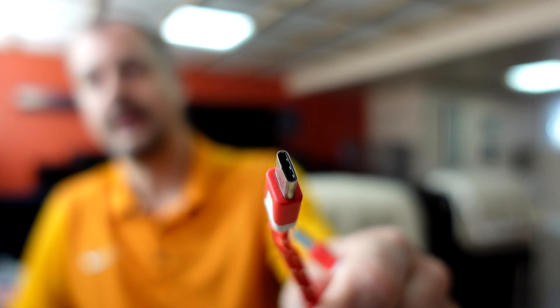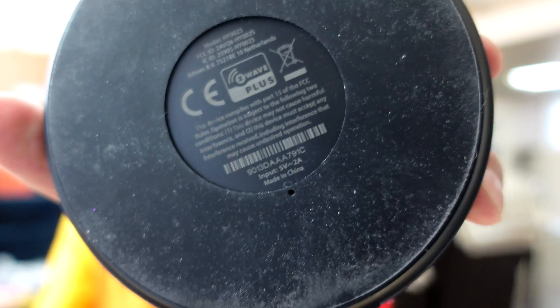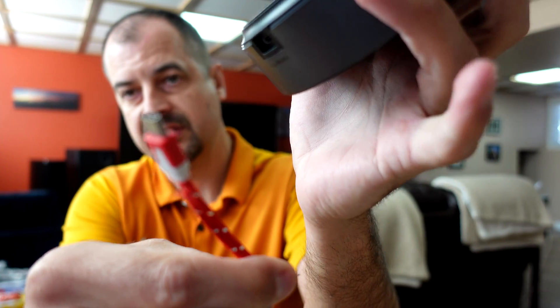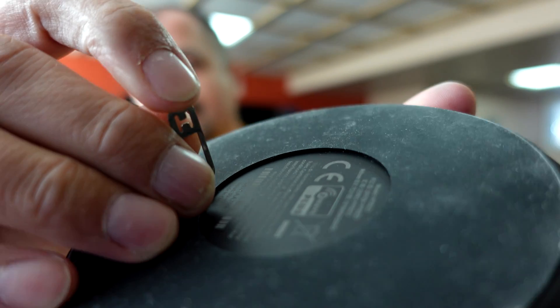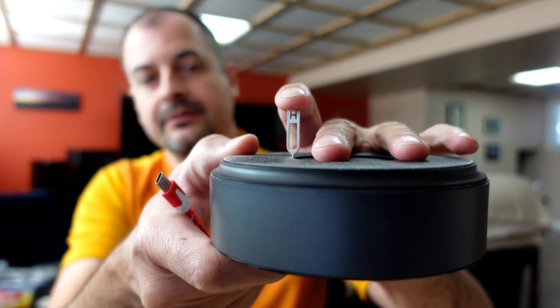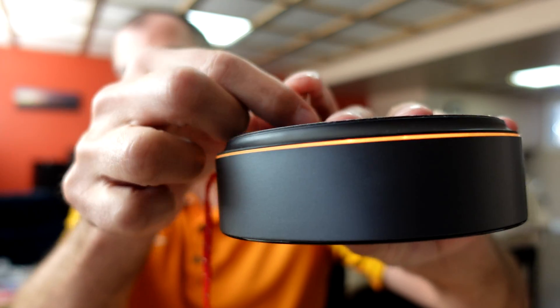The other end goes into your Homey Pro. You'll also need a pin that goes into the bottom of the Homey Pro. Push the button inside the small hole at the bottom while you connect the USB — you can kind of hear the click. That lets you know you have it in the right spot. Hold that down while you plug it in, and once you have an orange ring you can remove the pin.